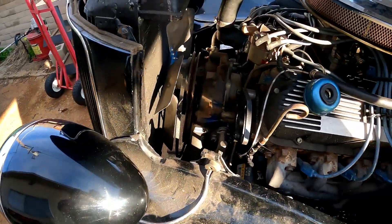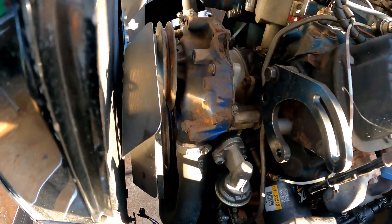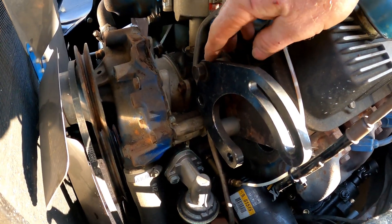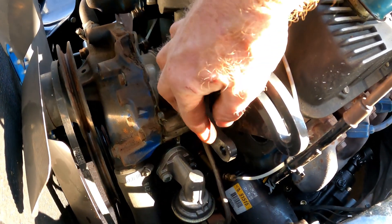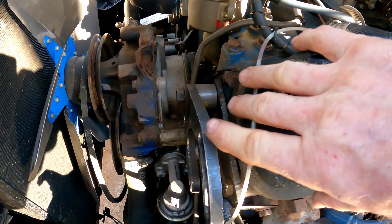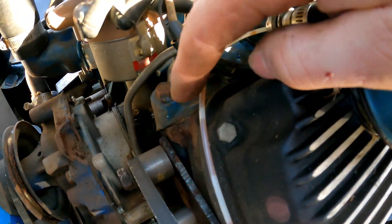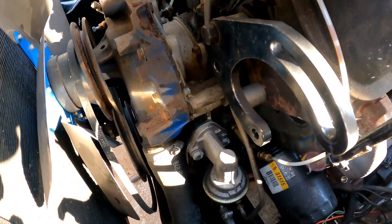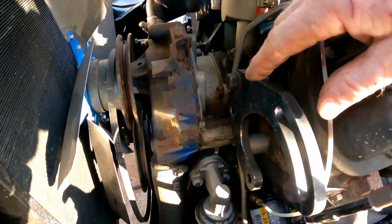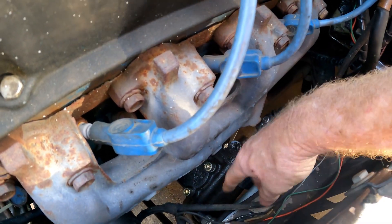They sell kits for these engines but they all sit out too wide for cars and trucks. So I had this GM power steering bracket — a low bracket from a GM 350 — laying around for a Saginaw box. It pivots and has slots, so it's a pretty nice bracket that'll save me some time. I made a little bracket that bolted to the head out of 3/16 steel with some spacers for mock-up. It looks really nice — it'll fit right here, lined up with the belt, and I've got room to put the lines on the back.